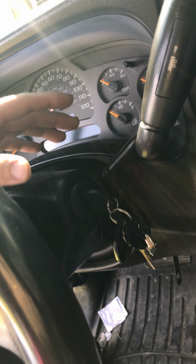They don't have the actual pilot hole itself, so it's a little harder, but essentially the dimple is the point you go off of to center that hole, so that way you can put your pedal on, because your pedal has a plastic collar on it that actually sticks about this far through the firewall that your master cylinder will go to and slide into and turn.